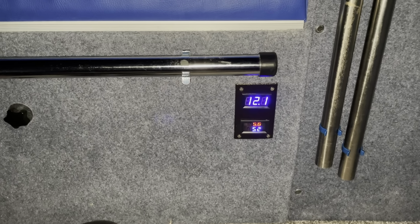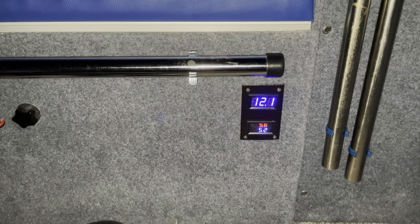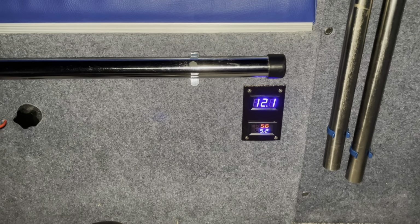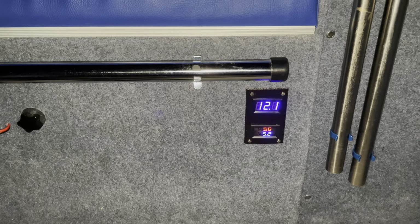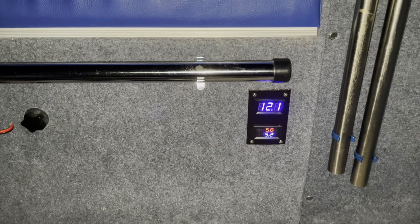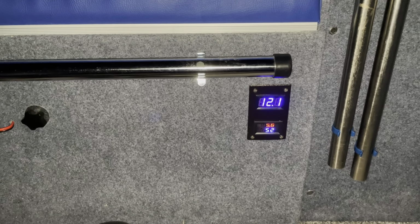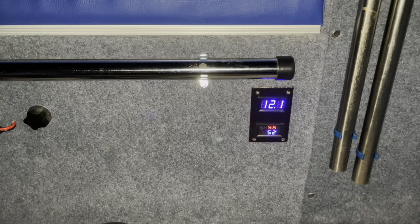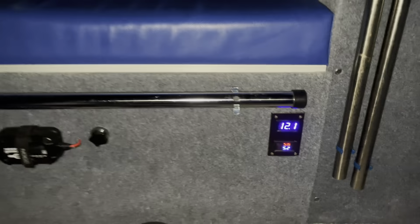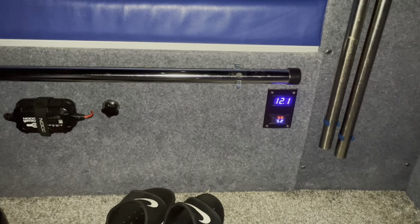So we got in the van at 5 o'clock. It's 2 o'clock in the morning now. So at 9 hours, we can quite safely say we needed to recharge the batteries. I've switched them all off and that battery will recover now for the next couple of hours, and that might be 12.1, 12.2 in the morning. But we'll see. The fan's still on because I don't want a moisture build up in the morning, and that'll run at roughly 0.6 of an amp all night.